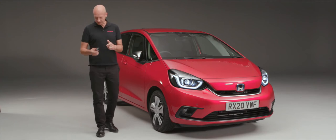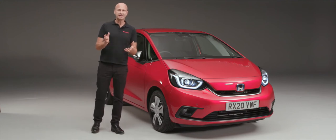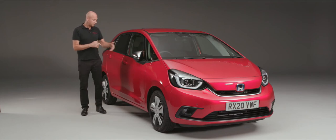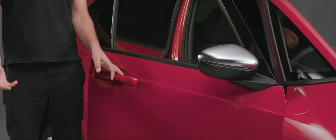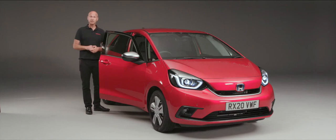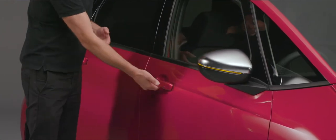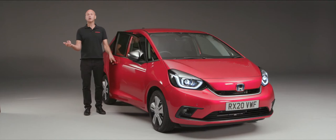There is a second way we can do this by putting the key in our pocket, handbag, jacket, bag — wherever — we can use the keyless system. As long as we're in proximity of the car, all we need to do is put our hand behind the door handle. You'll hear it unlock the car, and now I can open the car, and the door mirror unwinds. When it comes to locking the car using the same system, there are three little ridges on top of the door handle. All we need to do is make contact with those. It's locked. After a few seconds have passed, as soon as we put our hand in again, it will unlock the car for us.